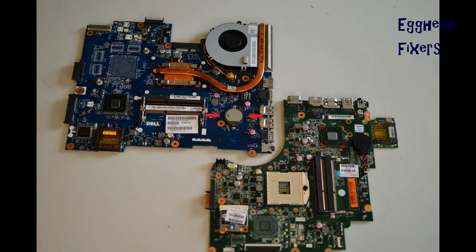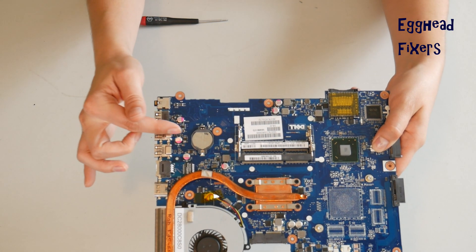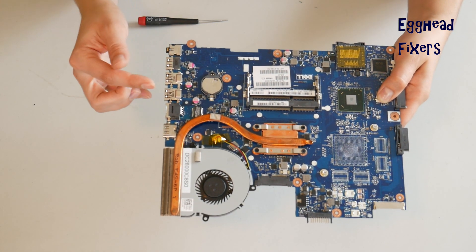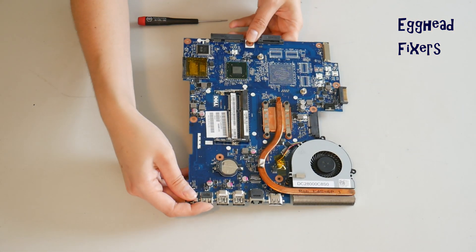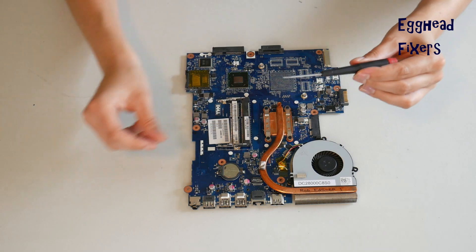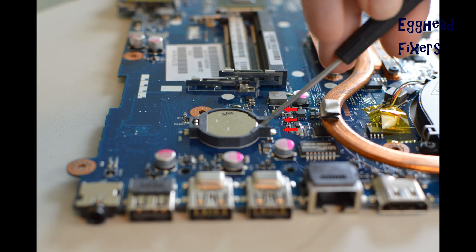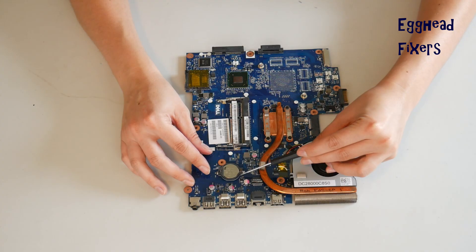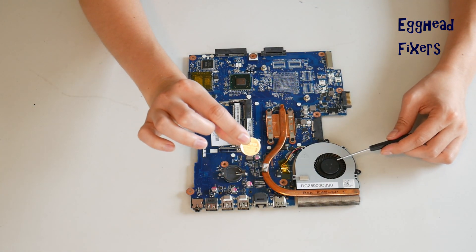Now for the cradle kind of CMOS battery. Cradles vary drastically from model to model; this is the most common kind, so we'll demonstrate on that. If your cradle looks different, you may have to adjust the way you do it — sometimes there's a flap or a piece of metal you have to move. For this kind, you take a screwdriver, set it there, and push it to the left gently, being careful not to break the cradle, as it's very hard to fix once broken.